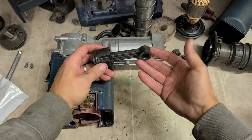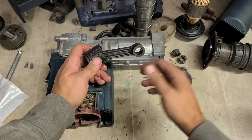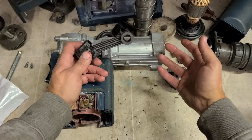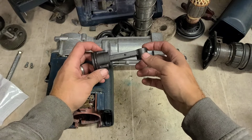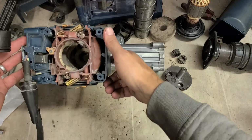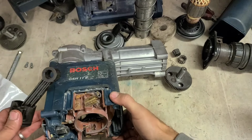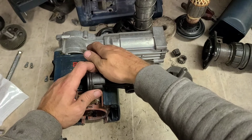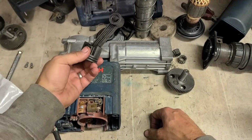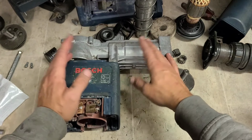Now, there's no point in me changing anything else, like O-rings or needle bearings up here, simply because this was worked out before. It was stripped down and rebuilt. I have no idea what was actually put under this. Somebody could have put a full service kit under this, and new seals and needle bearings, for all I know. That green seal down in there actually doesn't look all that dirty, so it could well be. So it'll be pointless changing that needle bearing because it could be brand new anyway. Same as the O-rings and the piston and striker. They could have already been renewed. Same as everything else, there's not much point in changing anything else in it.